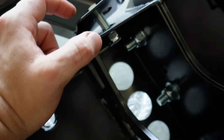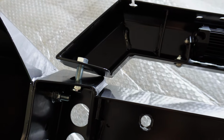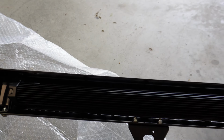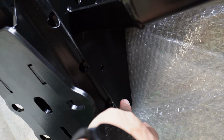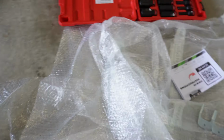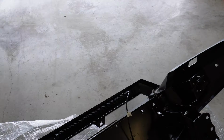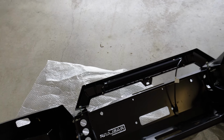And you just bolt that up through the two middle holes underneath the light bar. Then I use the last two big bolts for these side pieces for the light bar bracket. So they go in there. And then we'll do all that up nicely and that'll sit good. And then the radar bracket will sit in those two holes down the bottom there. So they'll go through and then they'll utilize the smaller big bolts, being them ones. Then really it's just take the front bar off the Patrol and put all the other stuff in, like sensors and the light washers, and do the rest of the little wiring stuff for that, and that'll be sorted out.